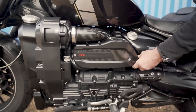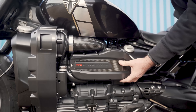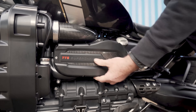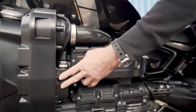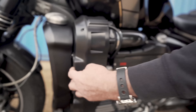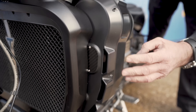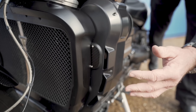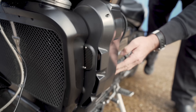This is our plenum chamber — it's not the original air box and we've finished it off with our carbon highlight, TTS engraved, supercharged. The oil tank for the supercharger is built in, and there are air vents at the front here to push air across the belt and across the front of the oil tank. The oil tank has got fins across the front underneath, so we're finding this works really well and the oil temperature is staying good.